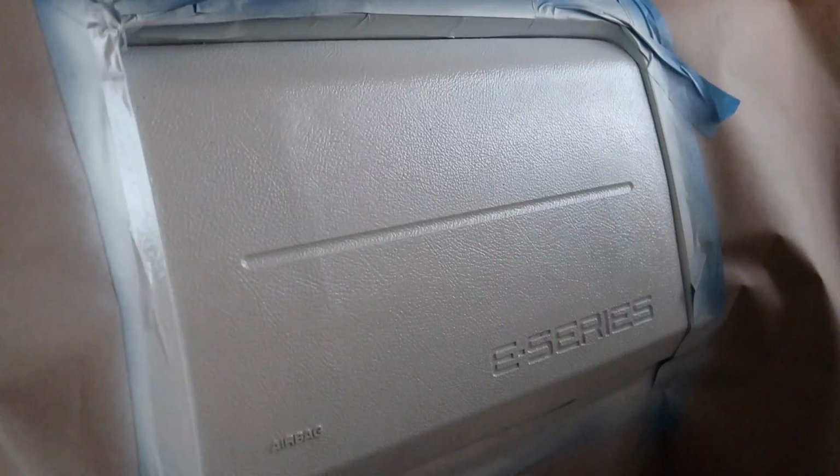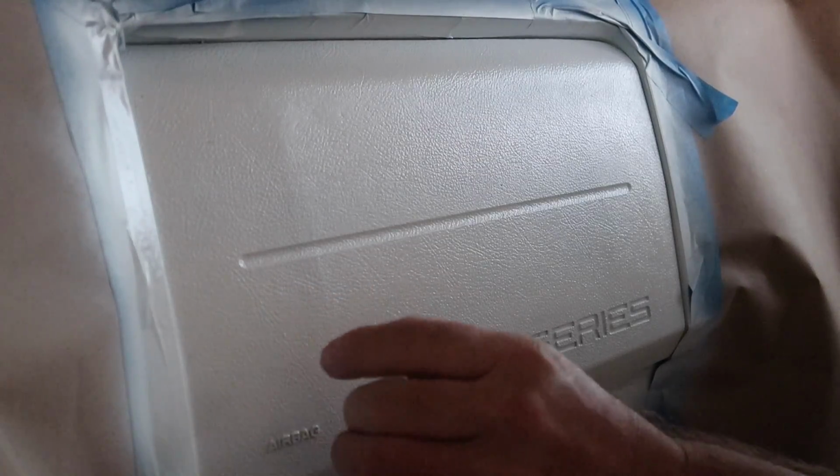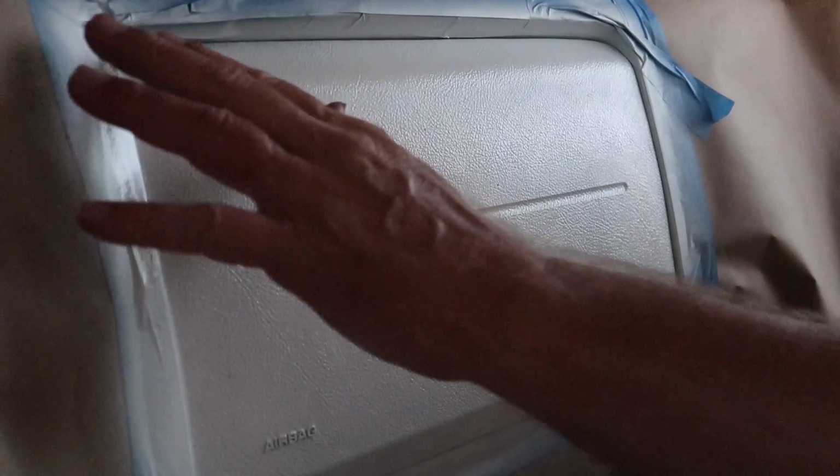We'll see. We're back, and looking over this a little bit, I think that I am going to do one more light coat on this. And after that, that's going to be the end of primer. This final coat, I'm going to let dry a little bit longer, probably about 15 to 20 minutes. And then I will go ahead and look at it, see how I feel about it, and then go ahead and do the top coat.